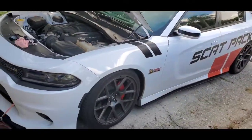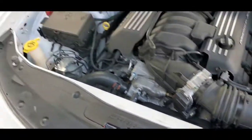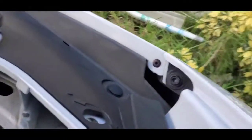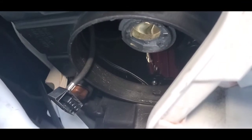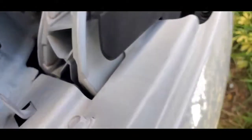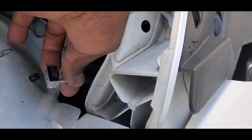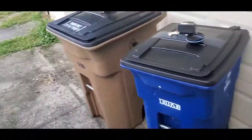Let me get my hood up and give you a look at the car. This is the passenger side — way in the corner is where you put your bulb. Those little beads around it are the little locking mechanisms that screw on the attachment connected to your bulb. That wire at the bottom is your actual plug — it plugs into your HID box. If you don't have HIDs, you're going to have a different type of plug.